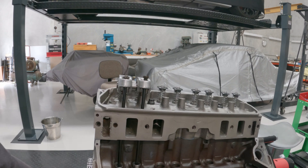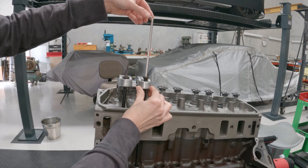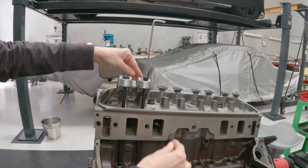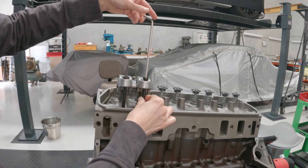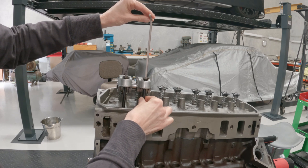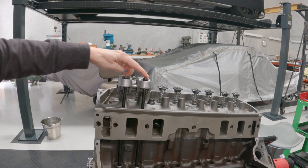Now I want to set the exhaust. I need that on intake closing. There's the intake opening and there it is closing — so now I know the exhaust is on the base circle of the cam. It takes almost three turns — let's say two and three quarter turns — to get rid of the lash on the exhaust. Then another half turn of preload, and the lock nut comes down. Not too different in how much thread is left on both of those.